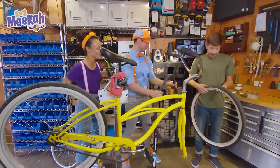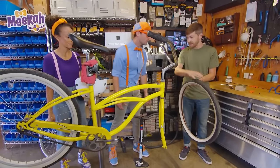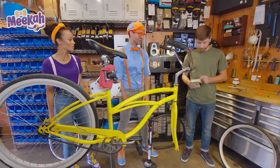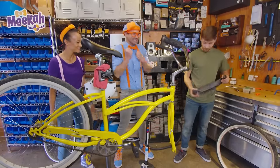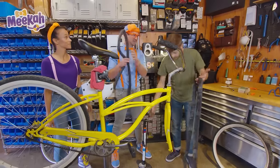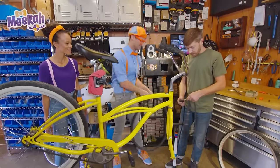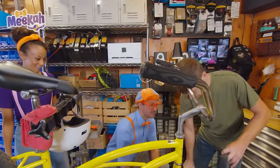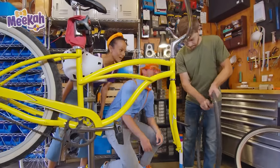Here you go. So, as we're now done inspecting the tire to see if there's anything stuck inside of this that created the flat, we're now safe to put a new tube back inside. Oh, okay, so it's just the tube that had the hole. Yeah, so you're gonna get a brand new tube. Yee! Whoa! Yeah, it looks flat. So that is this, but brand new? Exactly. So what we're gonna do is fill it up with a little bit of air to make it easier to install. Cool. Look at it. It's getting blown up.